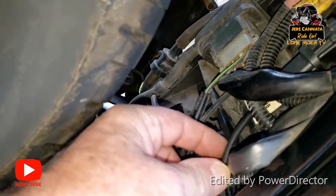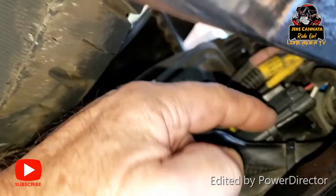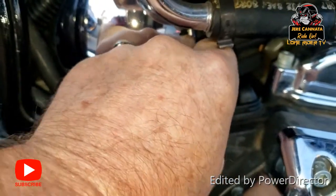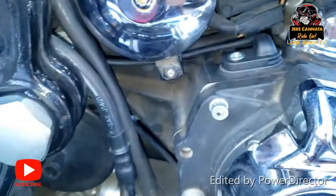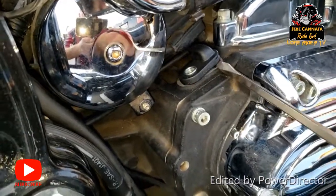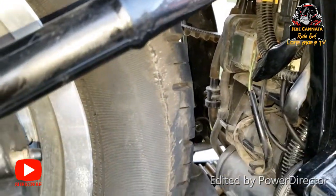Just make sure you've got a little bit of play in it. It goes up and underneath these wires, and there's the plug right there. Pop that loose, and once you've got it loose you can pretty much take it the rest of the way out with your finger. There's your Allen bolt that holds it in — just stick a screwdriver in there and pry it up out of there very gently. Now that you've got that VSS reinstalled, go ahead and grab that splash guard, hook it back up on that bar, put those two screws in, and you'll be on your way.